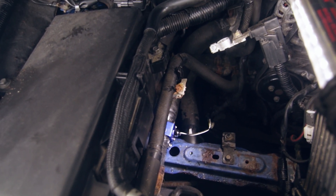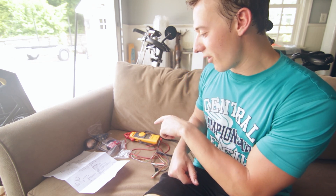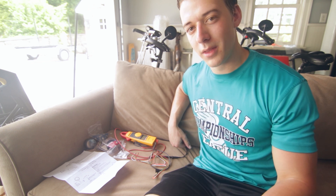Now we can work on all the wiring. There's an easy way and a hard way to do this. The easy way involves add-a-fuses, but it's not as clean and it messes up the fuse box a little bit. The hard way is cutting, splicing, and soldering into pre-existing wires — it involves testing with a voltmeter. That's what I'm going to attempt on this car because it yields a much cleaner look with only one wire running through your firewall. If you want the easier add-a-fuse method, I cover it in my previous gauge video linked in the description.